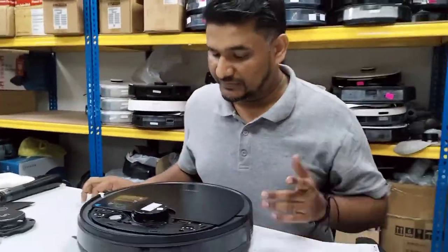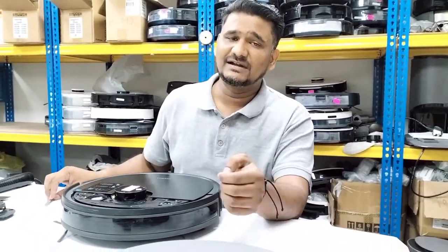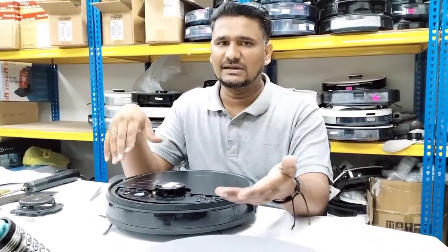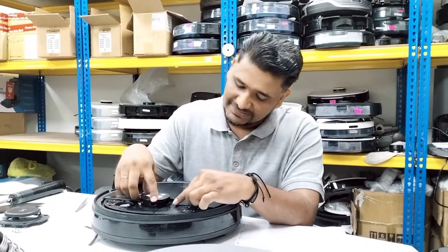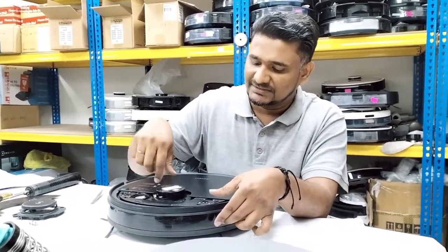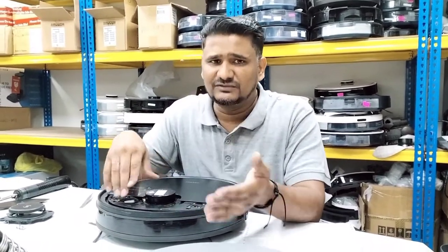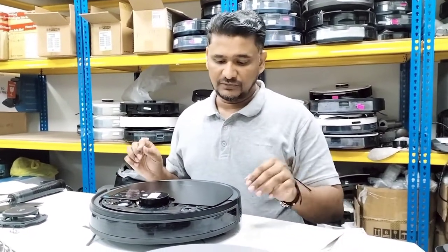Hopefully this is the only reason, and after cleaning it should start working again. If you also have this type of issue where the robot is not covering the full house — just comes out from the charging dock, cleans one or two meters, then returns to charge — first check whether there's something in the laser distance sensor assembly. Maybe something is inside on either side, or the turning mechanism is not accurate, something is stuck, the belt is broken or damaged, or something is touching the LDS. These are the reasons that normally affect mapping. Hopefully you liked this video — thanks for watching.